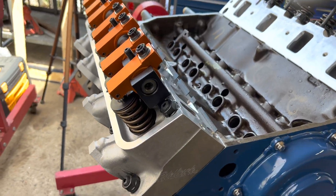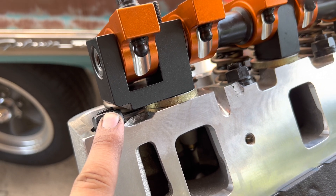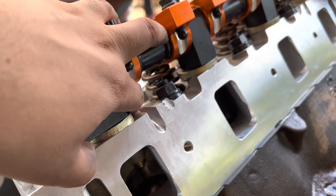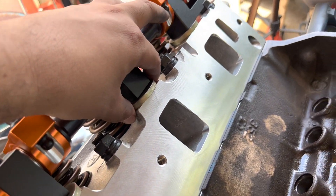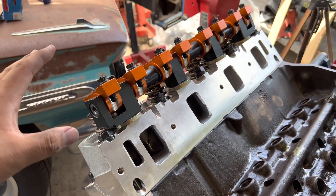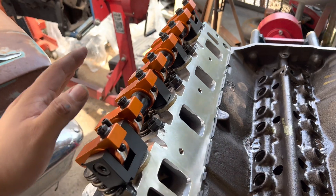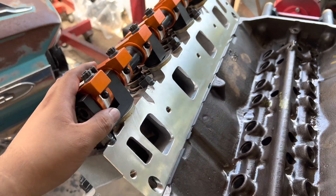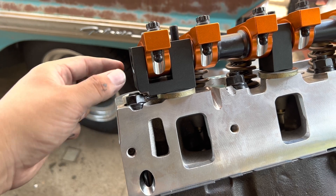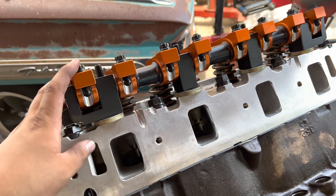The second thing I came across when installing the rocker arms is that it was hitting the stud right here. I also had a problem where it was not sitting down on the block. What we have to do is shim it — I had no idea that we could even shim these. I'm not going to talk too much about rockers and geometry right now as I've never done this before, so I'll do a lot of research on how to do this properly on the next video. But sometimes if you're running studs, you will have to clearance it a little bit so it won't hit the stud, and you also have to shim it.